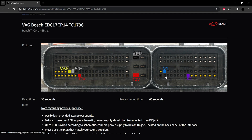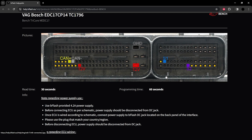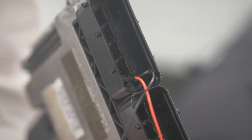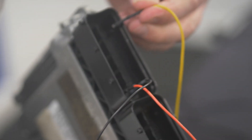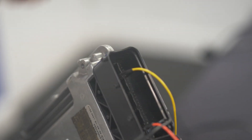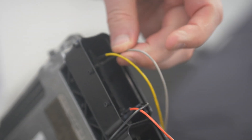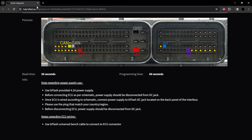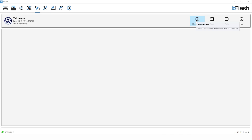The equipment we'll be using is our USB, our power supply and our multi-cable that has all of our cable connections on. When connecting to the ECU, make sure that the loom connectors and the image of the ECU matches perfectly the instructions on the screen. It's simply a case of following the instructions — the black earth cable goes to ground on the corresponding pin, and we need our CAN high and CAN low securely connected to the pins on the ECU. Once we've got all of our connections, close the instructions and we come back to the ID, read and write screen.